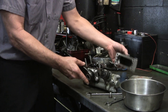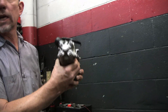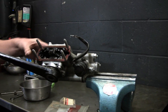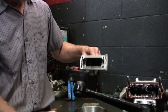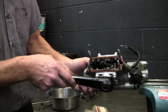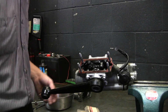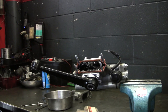I'm going to grab this in a vise. When you grab this in a vise you've got to be careful — if you don't grab this housing you're going to damage it. So I'm going to grab it right here so we can look at it. This is just a big cavity — it goes all the way up. You can see where the fluid level normally would run, right up to this fill part. The way this works is it has a shaft coming through here that goes across and connects to this link, and it pushes pistons back and forth. Now we're going to pull that thing out.